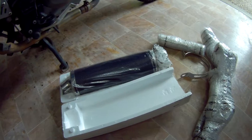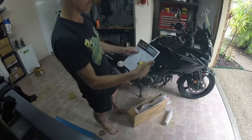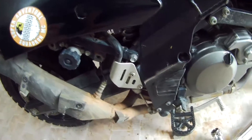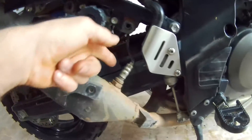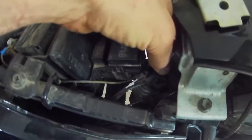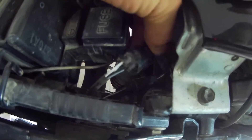Let's get it all out of the wrapping and we'll have a look at the instructions and go from there. I'm going to read the instructions. Before you go about unbolting the old exhaust, the first thing you want to do is take out this sensor. But before you unscrew that sensor, you want to get up under here and disconnect this plug so you can unscrew it without the wiring getting all tangled.